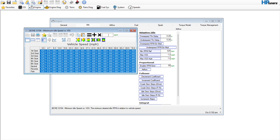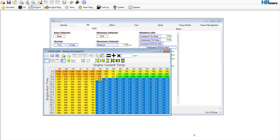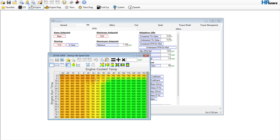Our minimum VSS I'm going to set all to 750 so it doesn't drop. Down here, to avoid overshoot as it's coasting down, startup in park/neutral — I'm just going to go everywhere in here that's not at 750 and make it all 750. Not really going to change anything else down here at least until we fire it up and see how it's behaving.